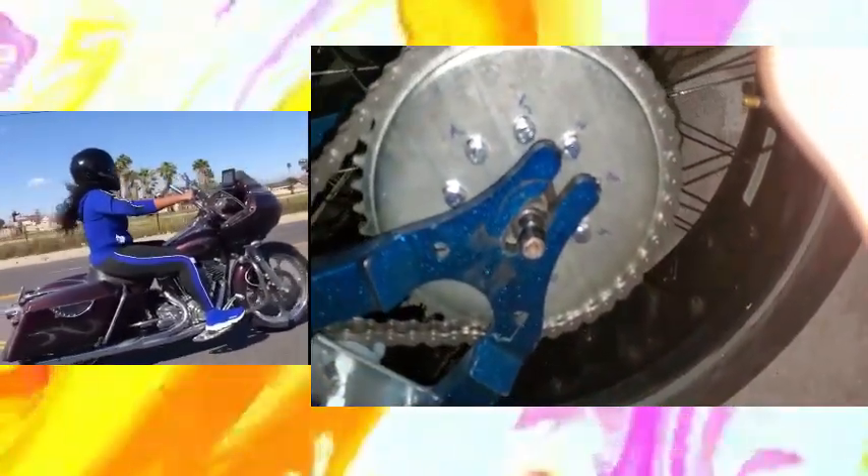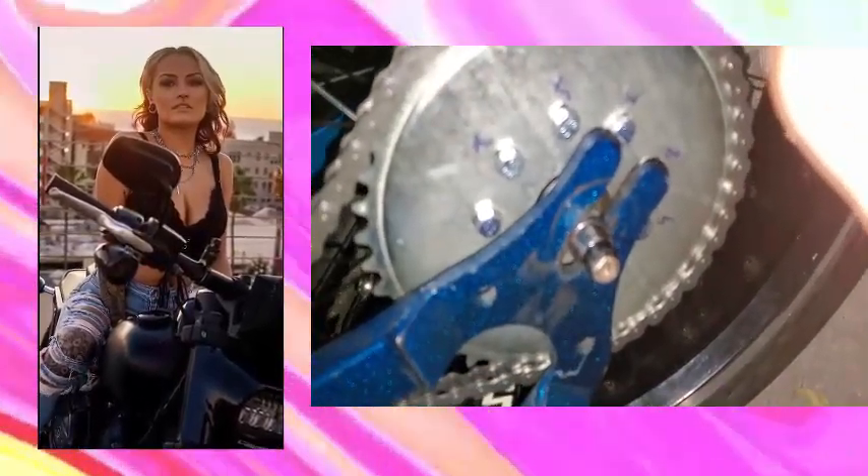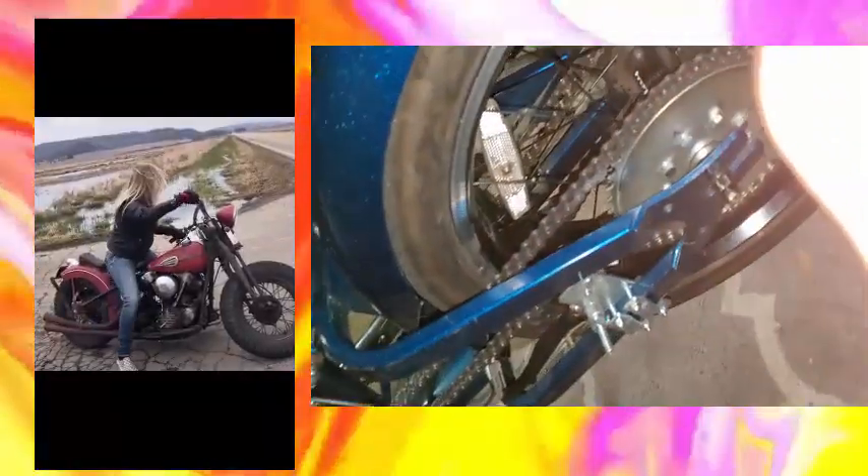This is one of the more critical parts of any bike build when putting an engine on it. What I do is I just go one, two, three, four, up to nine in a cross-hatch, back and forth pattern, so I can keep track of the ones I tighten and what's next. Rotate the wheel, tighten that one, rotate it another 180, back and forth — and that just worked perfectly. It really was very, very straight, so that went well.